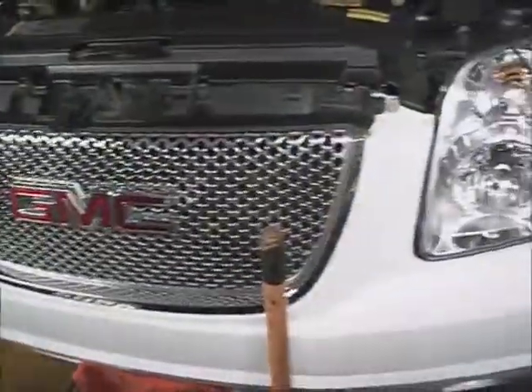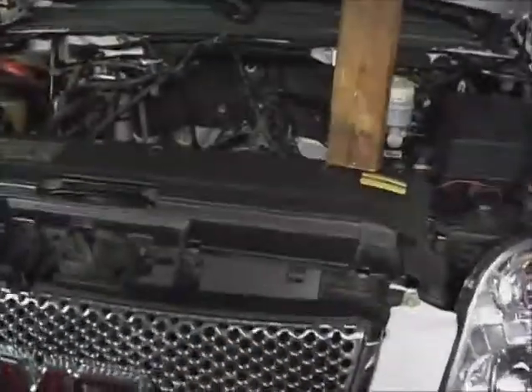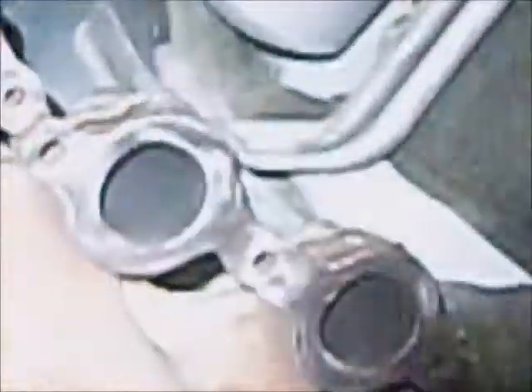Got the engine in front of the vehicle. I've raised it off the ground to engine installation position, with the front tires about four inches off the ground. Pop the wheels off on the front and run a jack underneath the transmission pan with a board on top to spread the load out, so I can maneuver it around when the engine goes down. I've already ground both manifolds pretty clean and ready for a gasket.